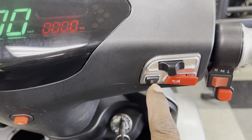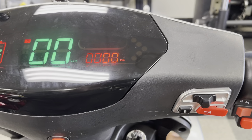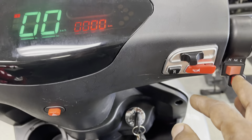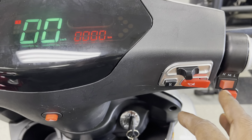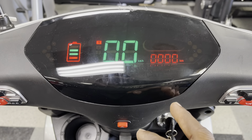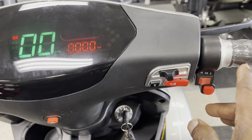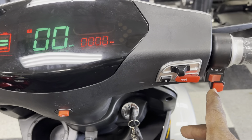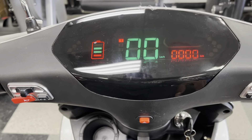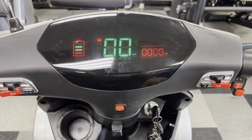This R button is an optional function for this scooter, which is not permitted to use for this mobility application. These dashboards are used in different scooters, so it's on here just in case you didn't have a connection for reverse. The only time this would work is if you disable the speed limiter, which would allow the scooter to go faster and would disable this reverse button — making this auxiliary R button the one that would need to be connected.